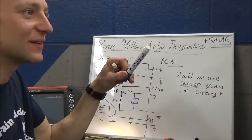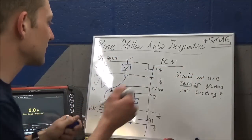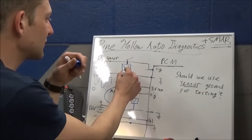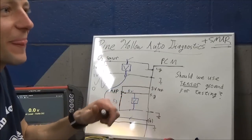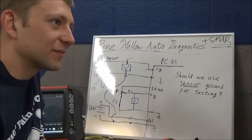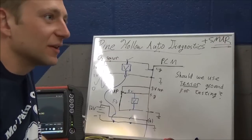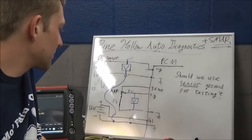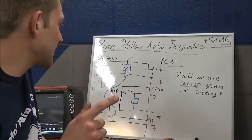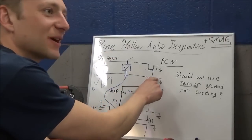It would be my habit, if I was going to do that, to check both wires for circuit integrity. I wouldn't have naturally stuck my voltmeter on battery ground. But if I'm going to the PCM, I personally would have hit both O2 sensor wires - they're right there, usually side by side. You're checking the whole circuit. So in this case, you have to do both checks to pinpoint this problem.